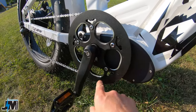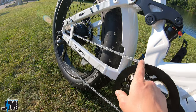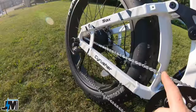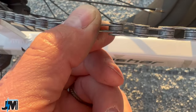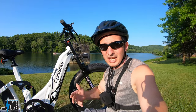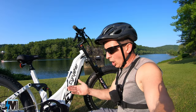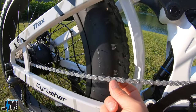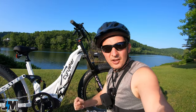The Shimano shifter leads down to the Shimano derailleur and 11 to 32 tooth nine speed cassette. KMC chain, 52 tooth chain ring in the front, and Welgo aluminum pedals. One thing to mention: when I first got this bike the chain popped off. The pin that puts the chain together wasn't fully pressed in, causing a slight bend that made it pop off the front chain ring. I reached out to Cyrusher and they sent a new chain and tool — took about two weeks. Check your chain where that darker link is when you get yours.